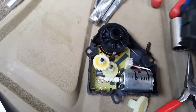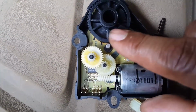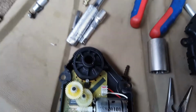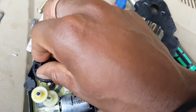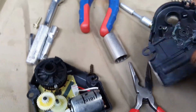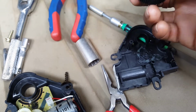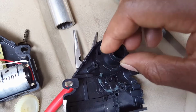So the only thing I did to match this up, where there's a little pointer notch in the actual gear, the main gear, was turn it until, on this right here, you can turn this over and put it in the top part of the cover. It's got two stops that'll stop you from going too far. It'll only go that far or that far.